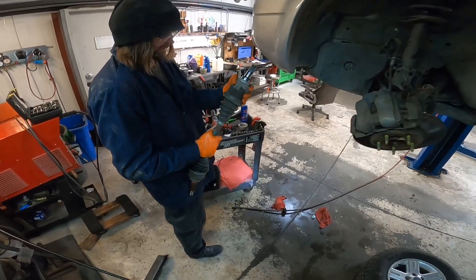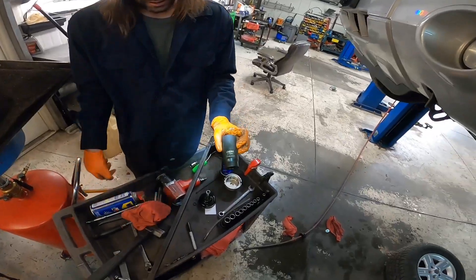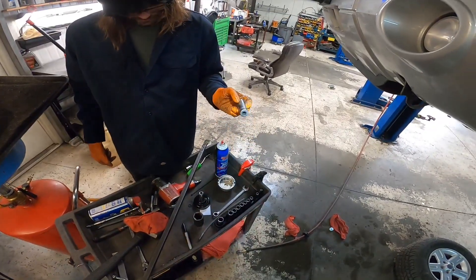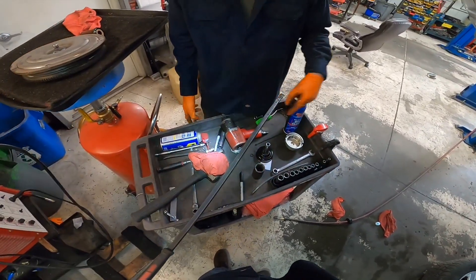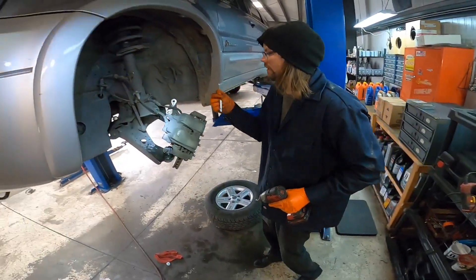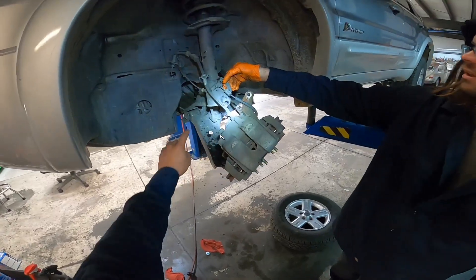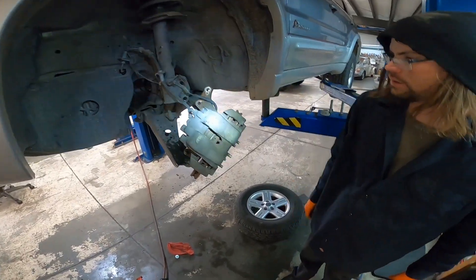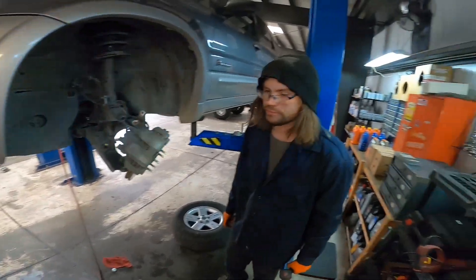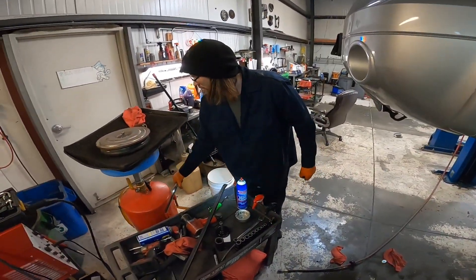This one clicks — this one's really bad. You need your 32 millimeter for the axle nut, 18 for the strut, and 10 for this connector here. Also grab a pry bar and a hammer — those are the basic tools you need. The 10 millimeter — I don't really know if I even had to take that out, but it's safe to get it out so you don't break something.